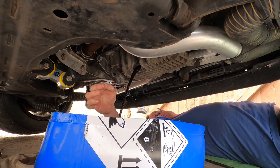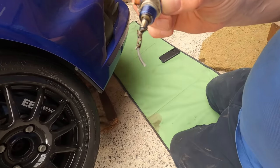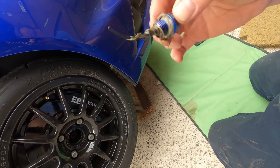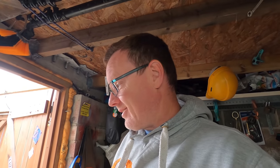I'm going to dig that out — looks like a ring. The first thing I find is definitely a piston ring on the magnet, and it's got PTFE tape around it — that's why it lost compression. That's what's left in the oil I've drained. There are some fragments of metal in there, so we can safely assume the engine is completely gone. Not even concerned with repairing it. Next thing: pull off the sump and see what it looks like — we'll probably find more rings in there.